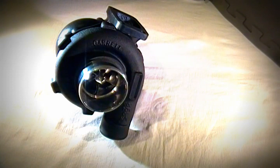For engine size application, when we look at four, six, and eight-cylinder applications: for the four-cylinder group, we're looking at this turbo to be used in a 1.8 to 2.4 liter category, especially those that have a high volumetric efficiency head. For six-cylinder, this would be in the 2.5 to 3 liter category — not a huge displacement, but something that's going to have a more aggressive camshaft to be able to reach over the 500 wheel horsepower range.